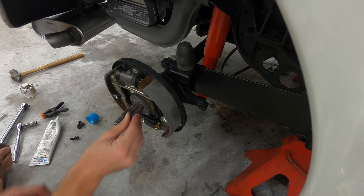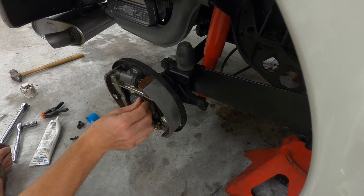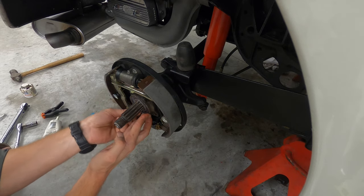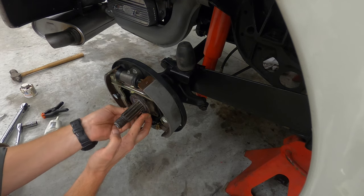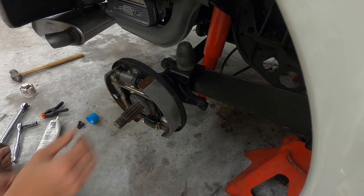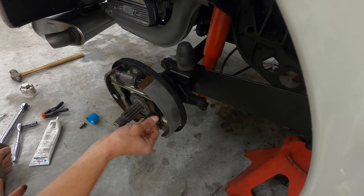Then put your hardware in — these are torqued to 33 foot-pounds, not a lot but a decent amount. Use a star pattern: top, right, bottom, left. I would suggest not going side to side. I'm going to torque to 33 foot-pounds and then come back.